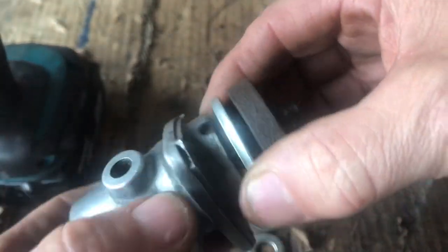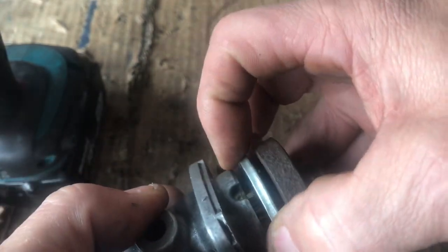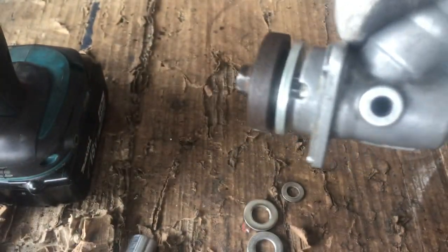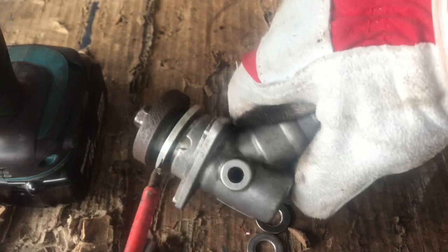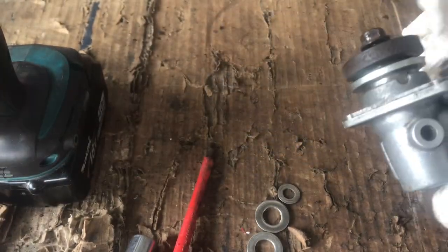So now what we can probably do is put another big washer on there. I'm just going to heat this up, put a screwdriver in there, and lever that off — hopefully I'll get the last bit out. Okay, that's hot. Now I can get a screwdriver in there for that last bit. Look, you can see it's come out even just with me doing that. Because you heat that aluminium up, it gets hot really quickly. So that's basically out now. A bit of heat on these aluminium castings and then things will come out. Look — it's just pulled right out.